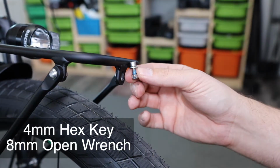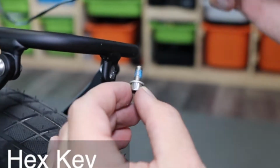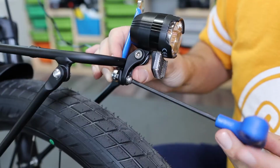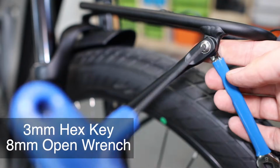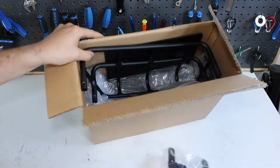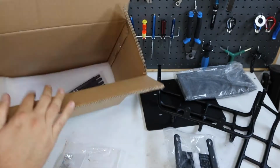From there, mount the nut and bolt combo, but be sure that you have the washer against the plastic mount, or that you picked up the right screw that has a wide enough head. After that is on, we're going to put a few zip ties on the wire to clean up the assembly. While we're here, we may as well tighten up the arms of the bracket so the whole thing is nice and solid.